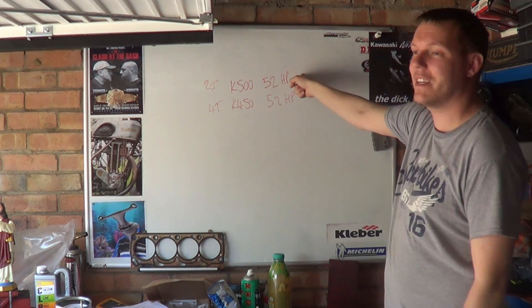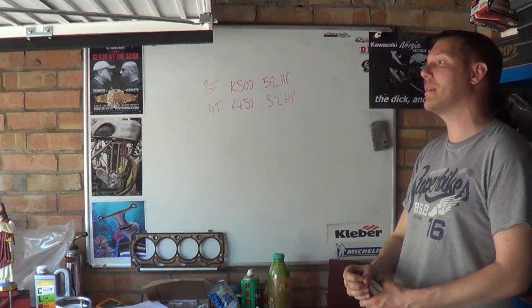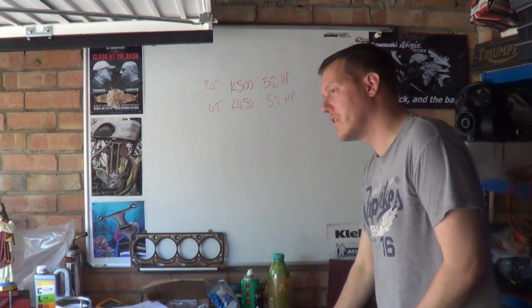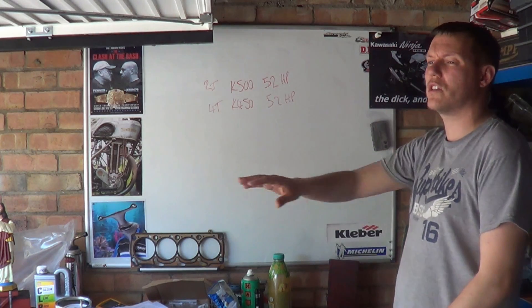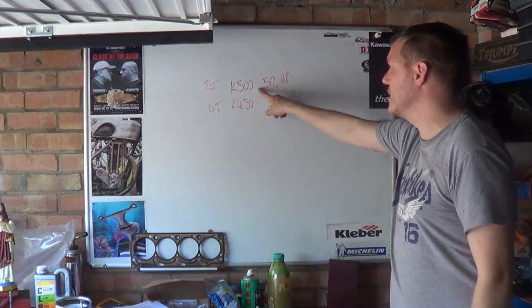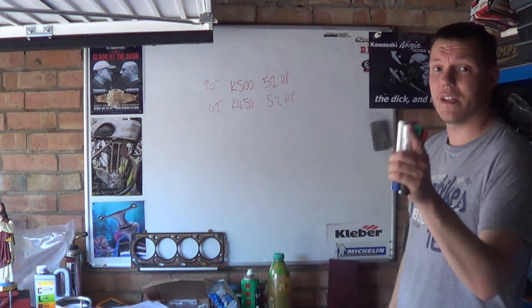They look at it, they do the maths, and they say: once you add this and this and this and this to a two-stroke, it ends up being a four-stroke. Let's just build four-strokes. People go, oh, KTM and BRP have made these two-strokes, they're bringing it back. They're not bringing it back - you're still pissing oil out into the air. As soon as you solve that by removing crankcase breathing and using a turbo or supercharger run off a belt, you start bringing down the actual power you're producing. Hope that makes sense, and I'll see you in a bit.